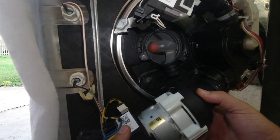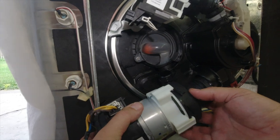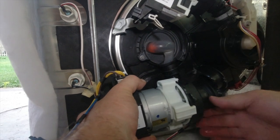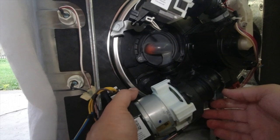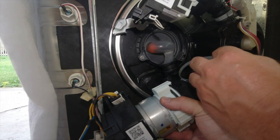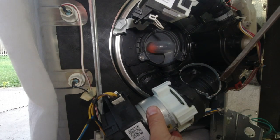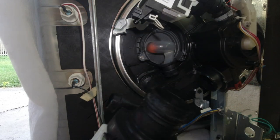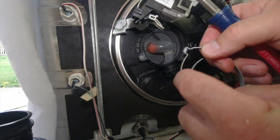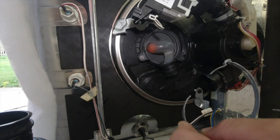The pump is held in place by a little clip here that slides in. The tube goes in here and slides on, held in by these metal clamps. To get these metal clamps off, take a screwdriver — very carefully, you don't want to tear any of the rubber — and stick the screwdriver into this part of the clamp. The clamp will be closed; you stick the screwdriver in and twist it, and it breaks the clamp apart so you can take it off.